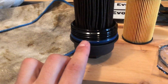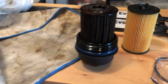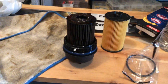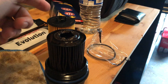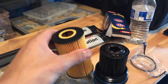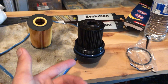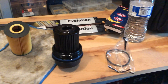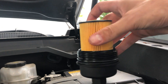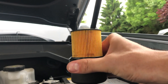We've got the new O-ring — it comes with the filter. Some people are lazy and don't swap it, but it's fresh and brand new and you paid for it, so you might as well put it on. Pop out the old one using a little hose pick, and the new cartridge goes face down with the little tabs. Make sure it's nice and secure and spins freely.